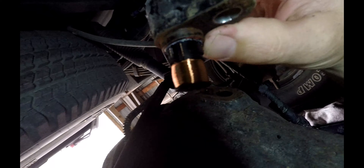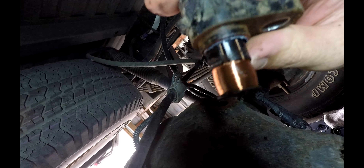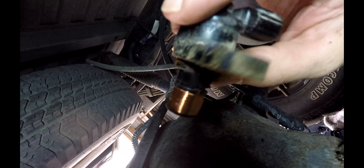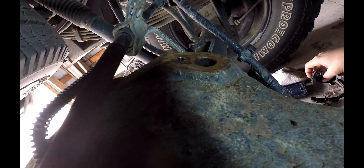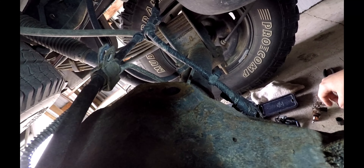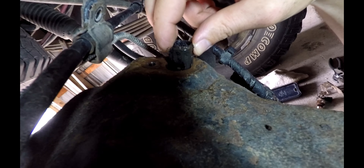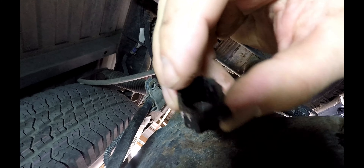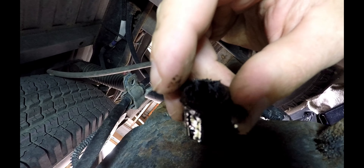I thought it was going to be easy to pull out. Here's a piece that came out, but if you can see, the whole bottom piece of plastic stayed in the hole — it was that corroded that it actually stayed in there. It's supposed to come out with the sensor. That whole bottom piece of plastic was wedged in that hole and I had a heck of a time getting it out. I used my pocket knife to scrape the inside edge to lift it up, then finally got needle-nose pliers between the outside lip and the inside, gripped it hard, and it popped out.